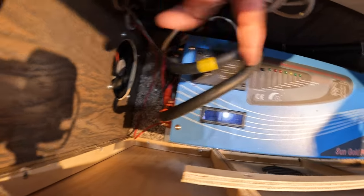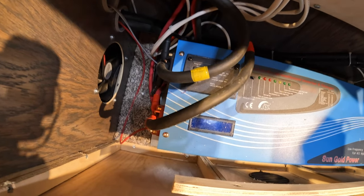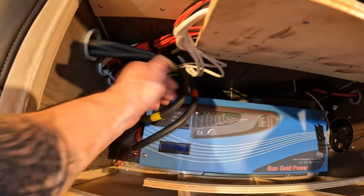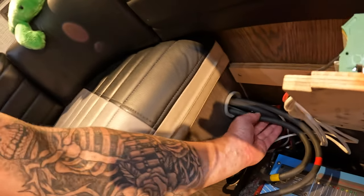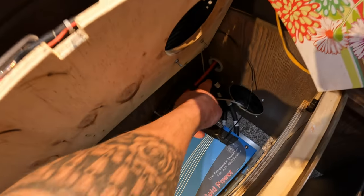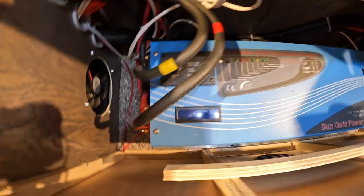I have parallel runs of 1-ought cable which you would have seen on the other side, and I also have my DC-DC battery charger on the same studs. So when the battery charger is on, it also takes those two 1-ought cables and carries the charge back to my batteries in the other compartment. These are more TAs — just like I showed you when I did the DC-DC charger install. I cut the throat off a TA and put a lock nut on it to use as a grommet.